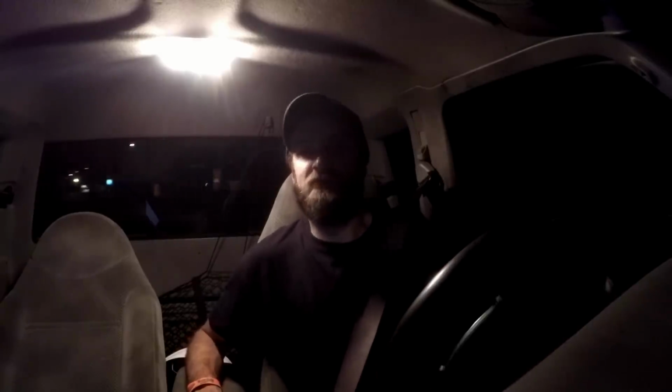So, hope I didn't hurt anything. It doesn't sound like it. Everything's driving and running really smooth. So we'll check it because we never know. Did show 5 degrees of knock retard, so that's never good. And it means I would say it was knocking at some point.